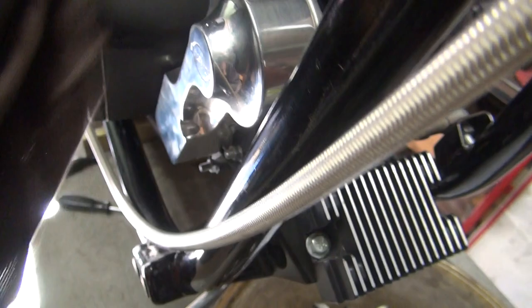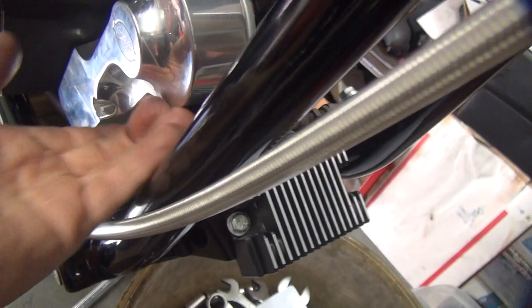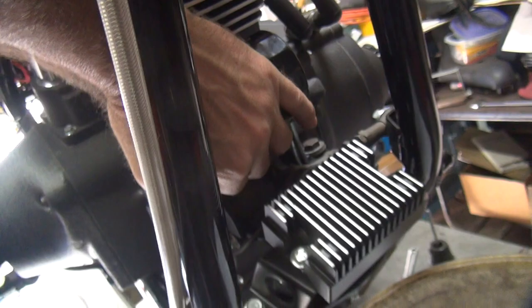Okay, so you want to make sure you wipe down all the leftover oil from assembly so that when you start the bike up and you feel around for leaks, you don't have any leaks already made before you even start it. Where's your oil filter wrench? Didn't you tighten the filter already? Well, you're supposed to tighten with your fingers. I tightened it hand tight, yes. That's how much you tighten them. You're not supposed to over-torque them, that breaks them. It's about half to three-quarters of a turn when it hits the gasket. That's all you do. No more than that.